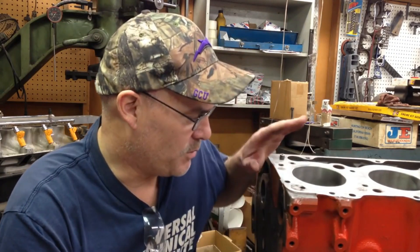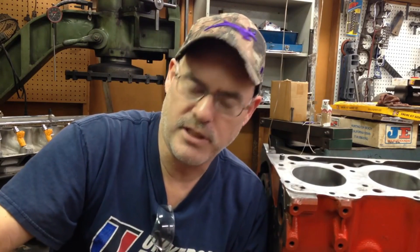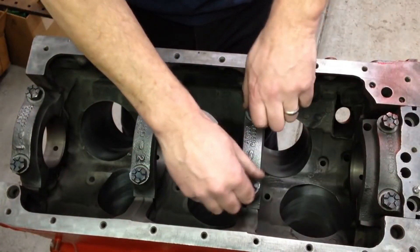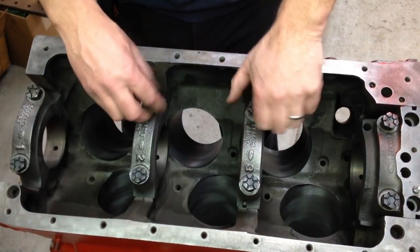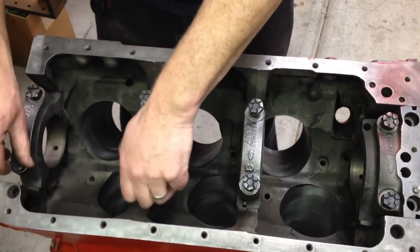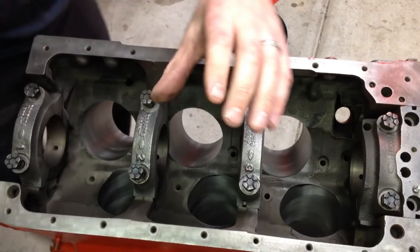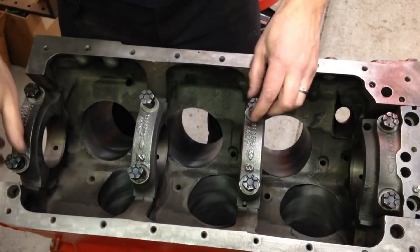If you're working on an engine with a lot of miles or wear, it would be advisable to bore the cylinders oversize or have a machine shop do it. We didn't have to do that in this case — we just went ahead and honed it. Now I want to draw your attention to the bottom of the engine. These are our main caps on the lower end. We need to make sure that the main bores are in alignment. Over time the main bores can become distorted relative to one another — they have to be in a perfectly straight line.